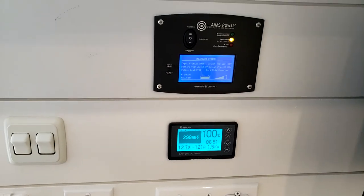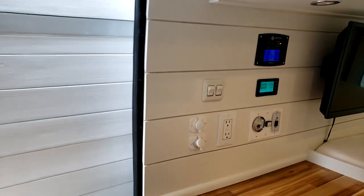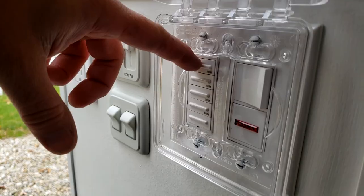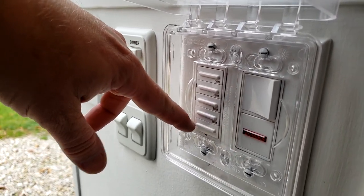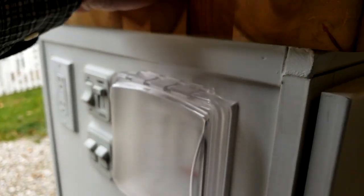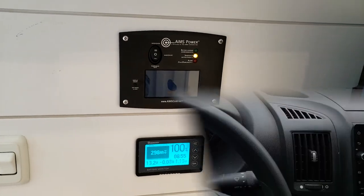All right, so we know the electric element works because as soon as I turn on the hot water heater, it's instantly pulling those kinds of numbers. And I have my hot water heater on this time switch. The max it could go is 60 minutes, which is long enough, and that way it automatically shuts off, which is important if you're using a battery with inverter setup like I am. But I'm gonna go ahead and turn that off because I'm just gonna take it for a drive now, and that's gonna be the true test. See how well the hot water heater works.